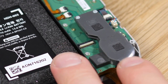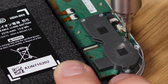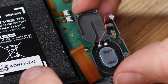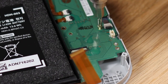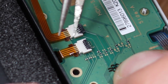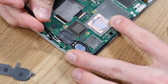We're going to remove the daughterboard on the right-hand side of the Switch Light. A really handy thing about this Switch design is that if you get joystick drift, you can resolve it without taking the Switch apart too far. You just do this process and replace the joystick — it's not underneath the entire motherboard, so you can do it with fairly low experience and very limited tools. This ribbon cable connects to the joystick, so you'll need to unplug that, as well as the ribbon cables for the LCD backlights and the small button daughterboard at the top.